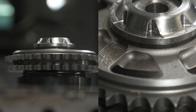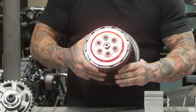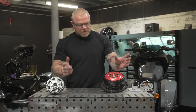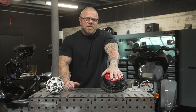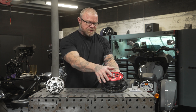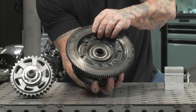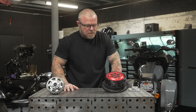That's what we're going to be putting in this bike today because it is going to get a turbo. We're also going to be replacing the clutch. This is an Evolution Industries clutch — available for cable and hydraulic, a completely built clutch assembly. The stock clutches will do good up to about 100 horsepower with the stock springs and stock basket. What generally fails when you start making a lot of power is the splines inside the clutch hub itself, because they're cast and they get spun by the main shaft which is harder.